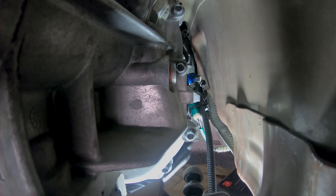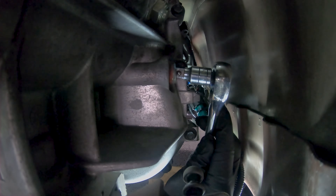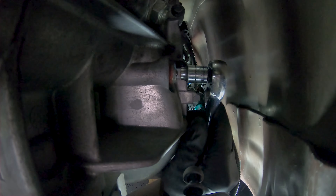Let's get under this thing and get that fluid out of there. First things first, we're actually going to make sure we can crack open the fill hole in the side of the transmission. This is important because if for whatever reason you have difficulty opening the fill hole, you don't want to open the drain hole and drain all your liquid out without making sure you can fill it back up. The fill and drain hole plugs have a 3/8 ratchet head as the socket, so you literally take the head of your ratchet and plug it right into the plug — that is your way to get the plug out.